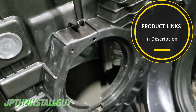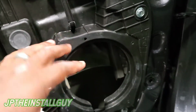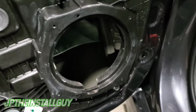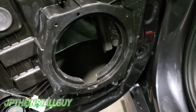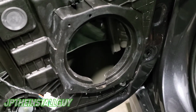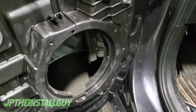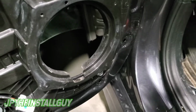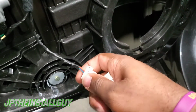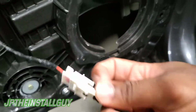Now, every time I do my doors, you see I have the window all the way down. That way, when I mount my speaker, I can tell whether I'm going to be hitting the window, hitting the tray, or whatever. Now, the speaker brackets that you need are the Metra 824300, if I'm not mistaken. I have those links in the description for you. But with these Kenwoods, we're not going to need that. The only thing we're going to need is our speaker harness. That way we don't have to guess what's positive and what's negative. It's going to take all the guesswork out for us, and they click on just like that.